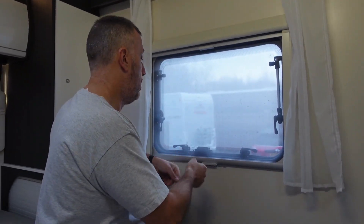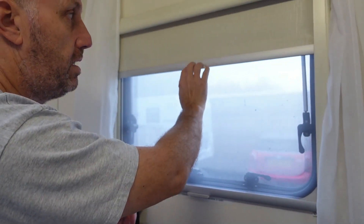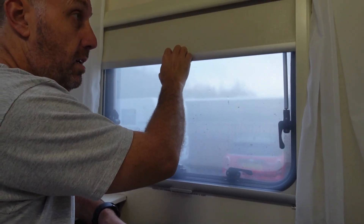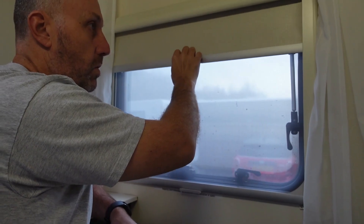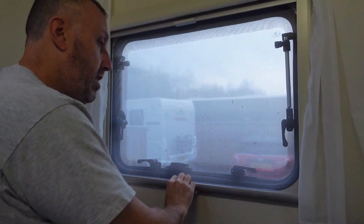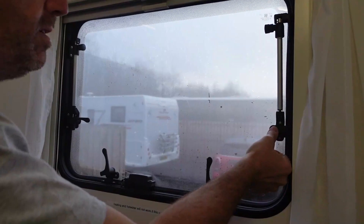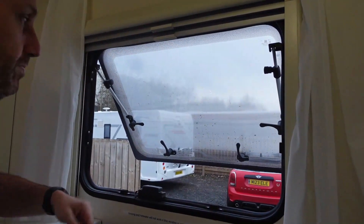Your windows have a fly screen and a night blind. They've got a little catch or hook on the side — it's locked in position, so just take it down a bit towards you and it'll release. Don't just try to yank it straight up or you'll snap the clips on the end. Just down a little bit towards you, then it releases and you can take it right to the bottom to make it nice and dark. To open the windows, push the buttons in, turn the four handles, and slide the window out. Turn the handles back in to lock it open. Opposite process to shut them.